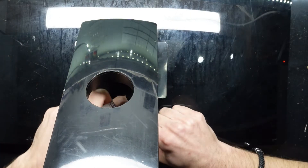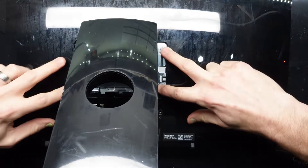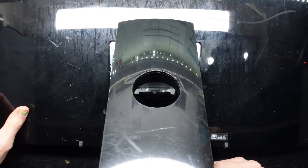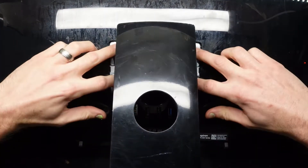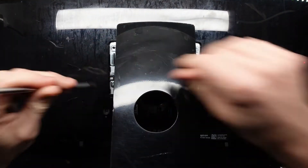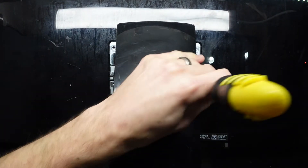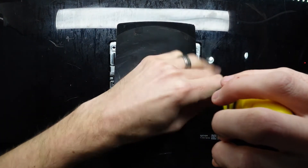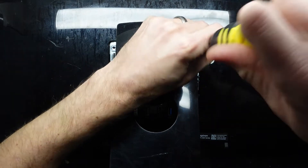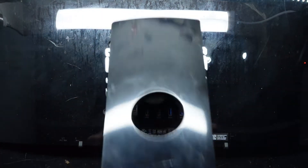To begin with, if I take off this back panel here, there's four screws here and here. There are four Phillips head screws to take off the stand. One, two, three, and four. Lift the stand up.